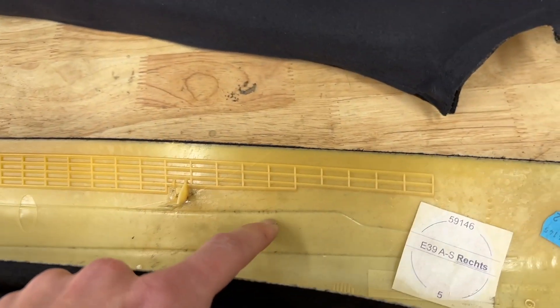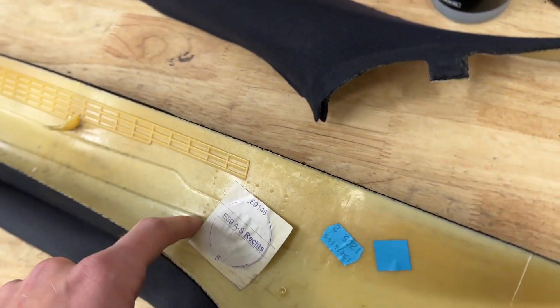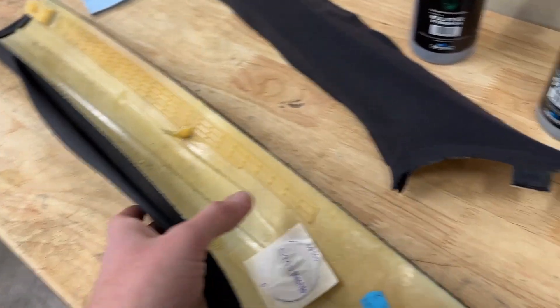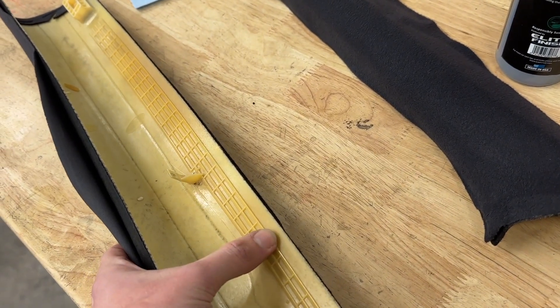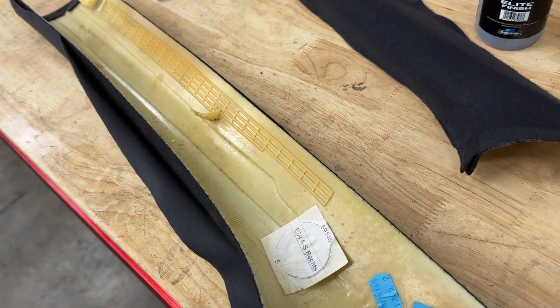You touch them and they split and break. The plastic backing has these two lines in it so that if the airbags blow in an accident, triggering the curtain airbags, the plastic just swings open and the airbag pops out. There's a built-in weak point, but it should still be flexible and malleable enough that you can carefully install and uninstall them ideally several times without them breaking.